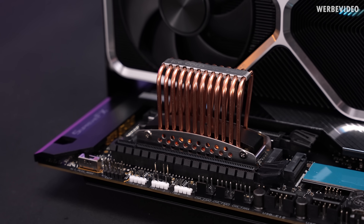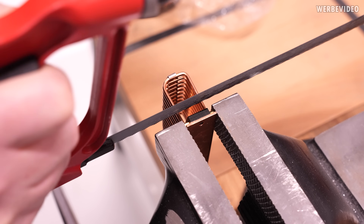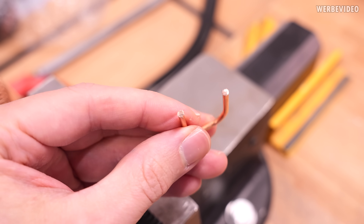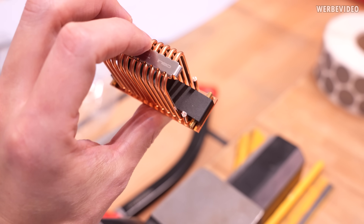The question that remains is: are those heat pipes or not? Only one way to find out — we cut open the 2.5 mm heat pipes and check what's inside. Well, there is nothing inside. It's basically just a thick copper wire. That's it.